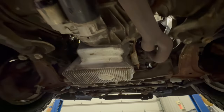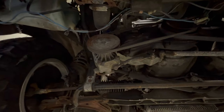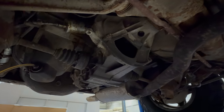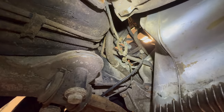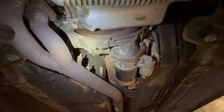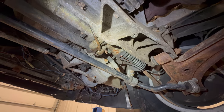The engine looks pretty clean. This car still has the air conditioning compressor and there's a tiny power steering pump over here — looks like the power steering is leaking just a little bit. These cars do have transaxles, but the clutch itself is right on the back of the engine. This line right here is the hydraulic line that runs down to the slave cylinder. Can't see much from down here, but everything looks okay. Besides the leaking power steering, I don't think there's anything that needs to be addressed immediately under here.